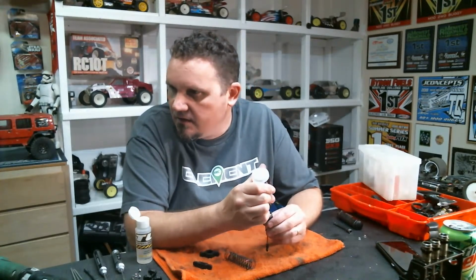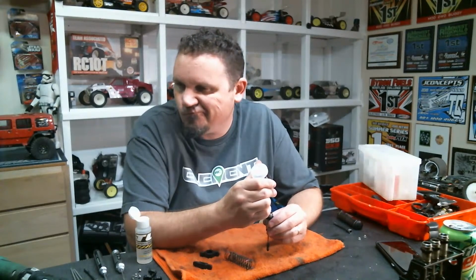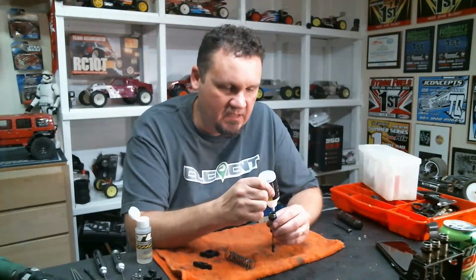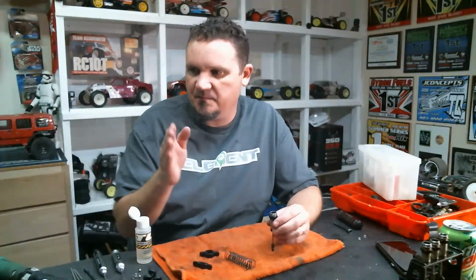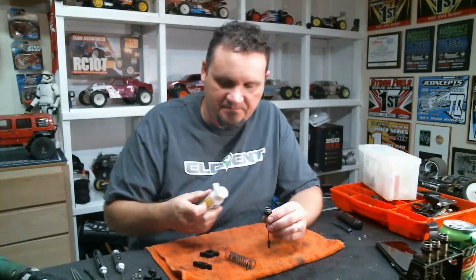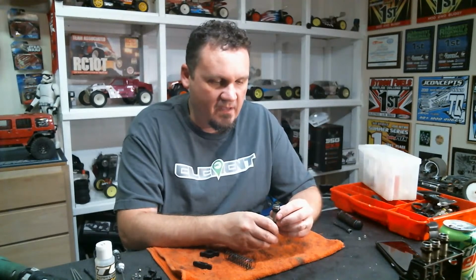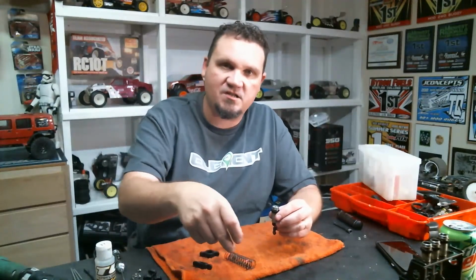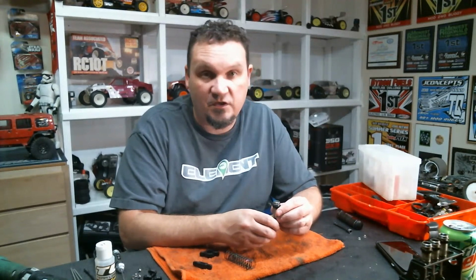Camber question: does camber change slightly between sets of tires? Do I just tweak every time due to the tire, or is it a setup station? Boy, there's a tiny little bit of slop in all of our cars, right? So it's always going to be moving one way or the other slightly. I would tell you not to worry about it that much. Having a setup station is pretty awesome, but just going over to the tech table with your camber gauge and double checking to make sure that it's the same as last time is all I think you really need to do.